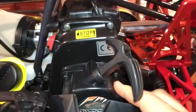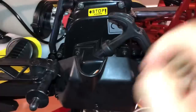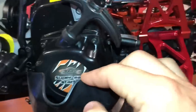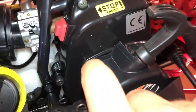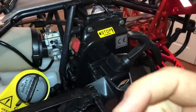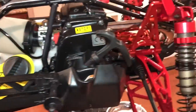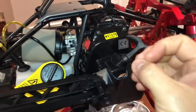We're gonna keep this pull start here for now. I will remove it in the future and change the flywheel — put a normal flywheel pull start. These pull starts are super easy but sometimes they do get clogged up. If you're gonna keep this, I highly recommend drilling a couple of holes over here so you get more air sucked in. I did not do it to my 5B 45cc Rovin and it ran fine. Some people say they have overheating issues, but I had my thing clogged up with grass and it still did not overheat.